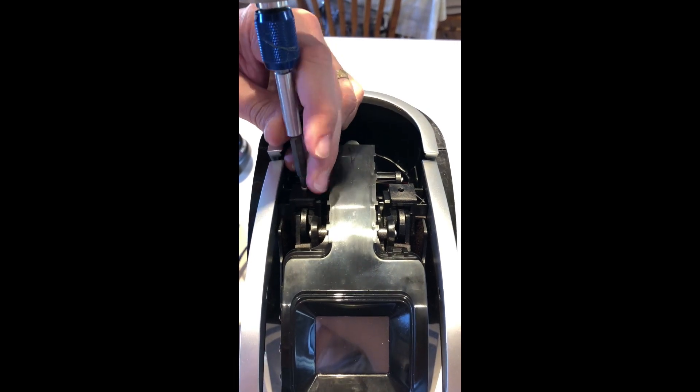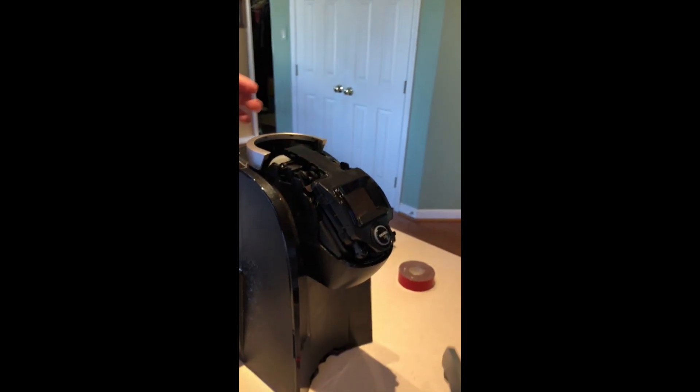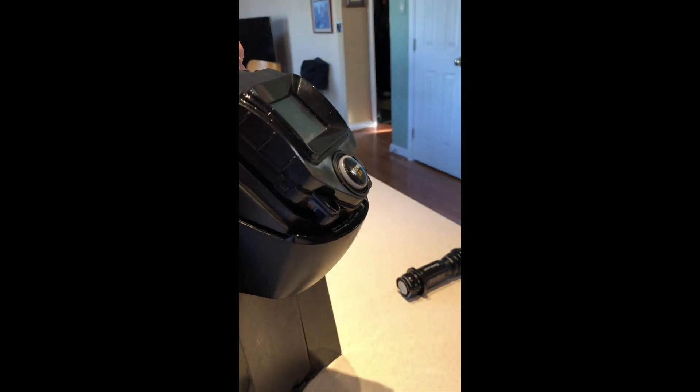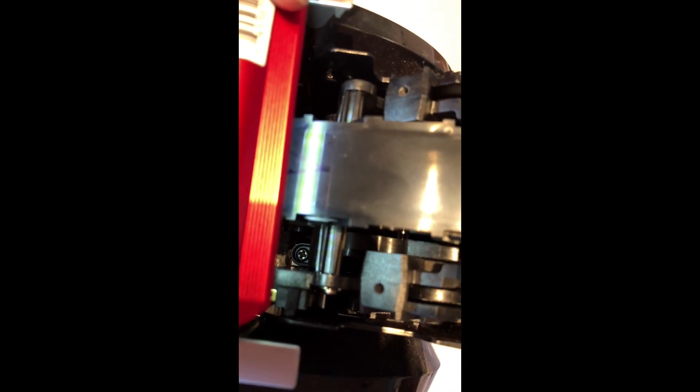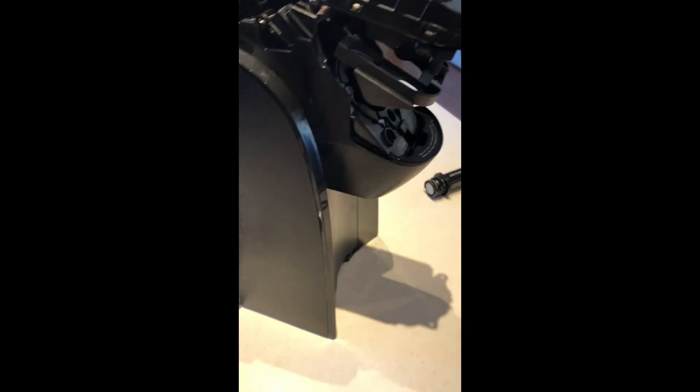It's not difficult to take apart or put back together. You just squeeze it a little bit and it snaps off. If you look down into here — you can take out the k-cup holder by pushing on those tabs and pulling it out — down in there those tabs keep that piece in. If you look down into the gut of the thing you'll find those two tabs.